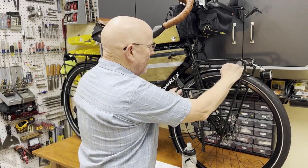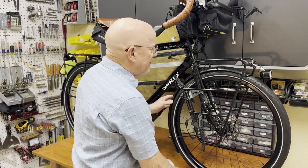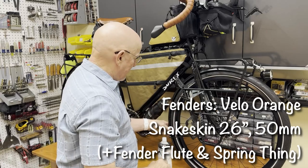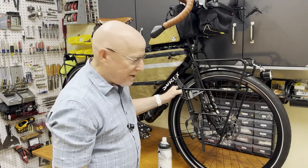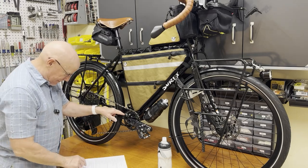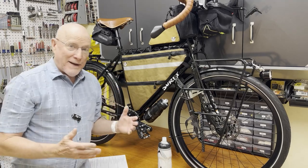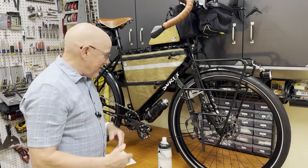Fenders — I really, really like these fenders, and that was a lot of shopping. These are by a company called Velo Orange and these are their Snake Skin fenders. They only came in aluminum color for the size I wanted, so I've spray-painted these several times with what I hope is good primer and very good paint that'll last for at least most of this ride. These snake skin black fenders keep crap off me during the ride. I had some trouble with the rear one rattling quite a bit, so I've added some parts also from Velo Orange called Problem Solvers — a little spring and some other pieces to stop it from rattling, and now it doesn't at all.